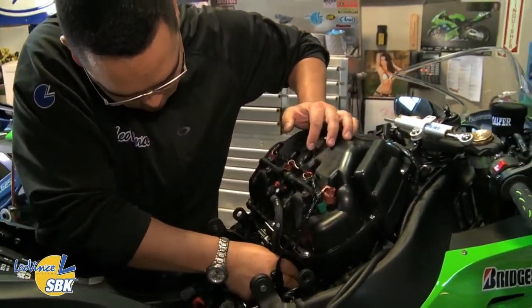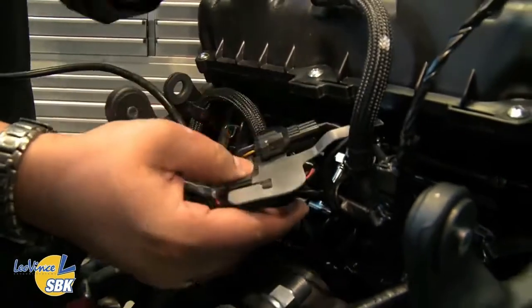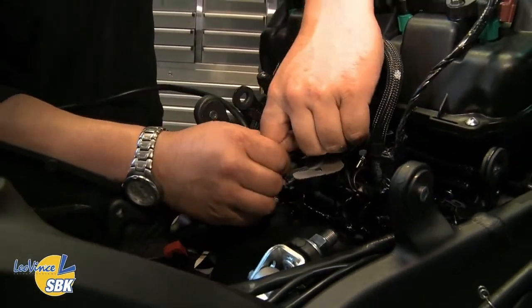Once you've got the injectors plugged in, the next step is to plug in the crankshaft position sensor. On this particular model it's hidden behind a little bracket, so you have to undo the bracket, look behind it, get that connector unplugged, and ours plugged in line with it.